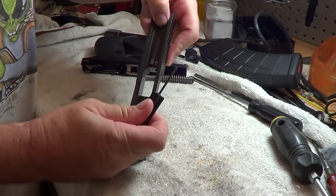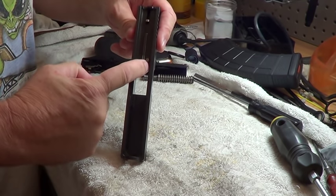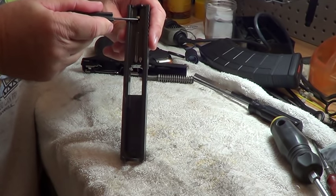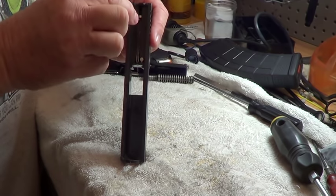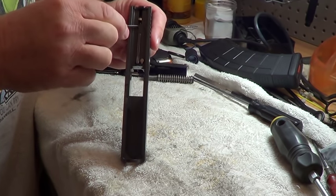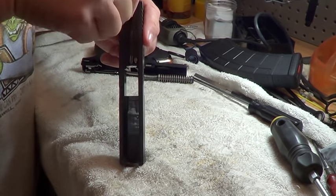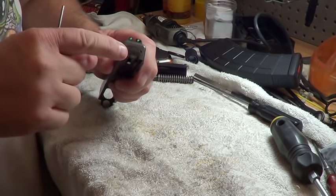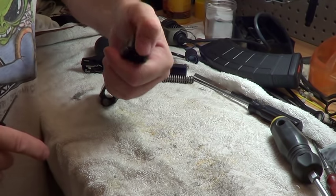this will go down. And then when I pull that back, that's going to click and it's going to move up. Okay? So when you move that up, right in between there, you're going to see a little plastic casing right there. That's what you want to push down. That tension, I'm pushing it down this way, that tension relieves pressure so I can slide this back piece off.